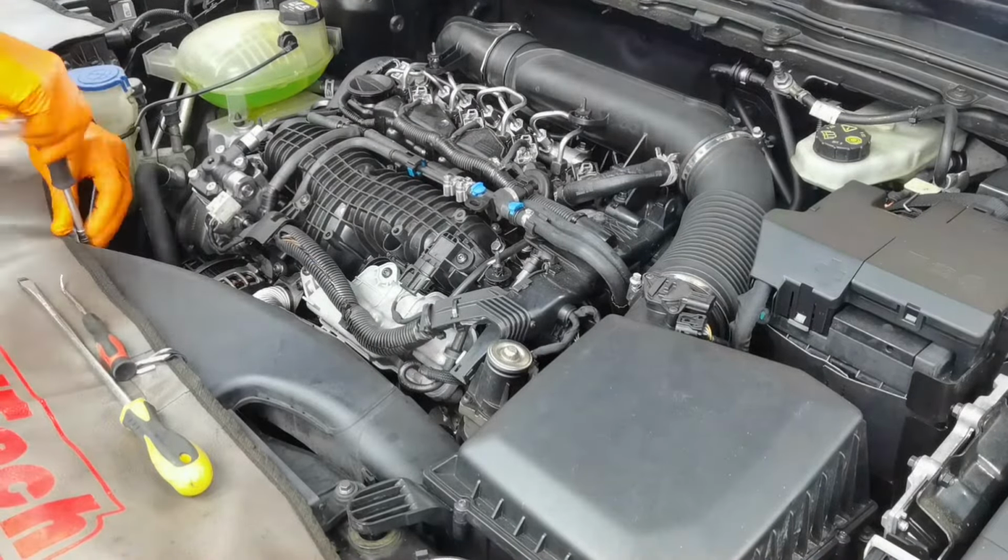And also after that, you'll have one metal hose which is going from the high fuel pressure pump into the injector number 2. After that, I recommend all to also disconnect the connector from the high fuel pressure pump because in this way, you'll have no risk of breaking it or bending it in any way where you can create any damage.